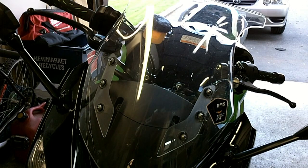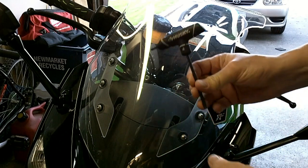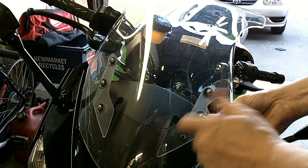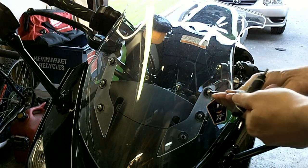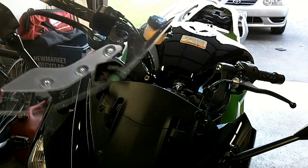It's not totally necessary, but I like to remove the shield — you'll see why after it's off. Use a number 4 Allen hex head screw. It's just 6 bolts, really simple. Don't forget these have little plastic washers on them, so you want to keep track of those. And there's the last one — give it a little tug and off it comes.